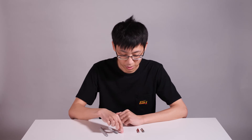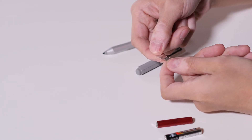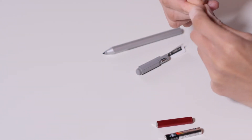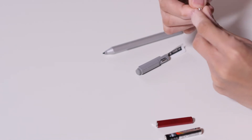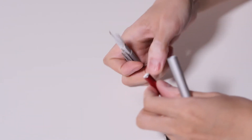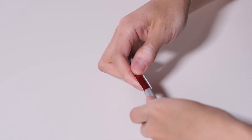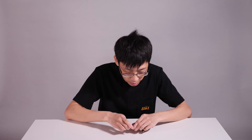If that's your case, you have to use something to make up for the height difference. I'll demonstrate two different methods. The first one is very easy, and you should have the material readily available at your house — it's just a tiny piece of aluminum foil. We all know it's conductive, so all you need to do is make a little pad, flatten the foil, and now we have an artificial positive terminal. Put it in the battery slot and carefully install the battery.